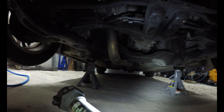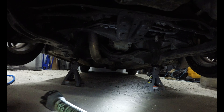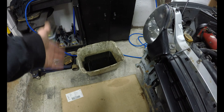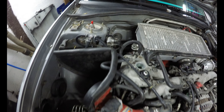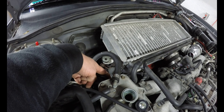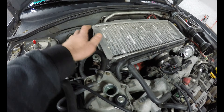The downpipe has taken a couple hits because this car was pretty slammed. I'll probably try and clean up the oil pan and reuse it, but I'd like to replace the exhaust manifold and its shield with a stainless header. Looking further down the car, it's a lot cleaner than the RS is, and that's why I'm planning on using this chassis. I've got most of the coolant drained out — it appears to be Subaru coolant.